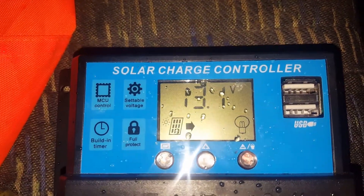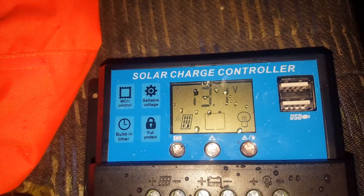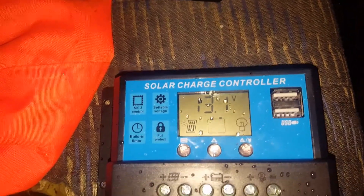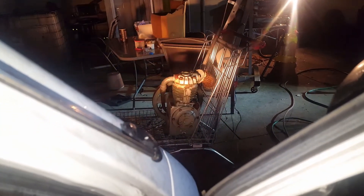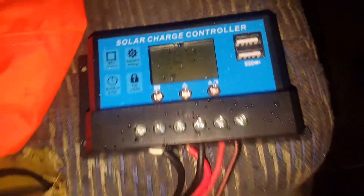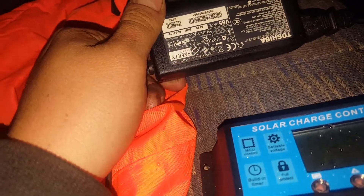It's been about 10 minutes. We're dipping up and down into the 13s. There's a little bit of warmth in the charger — nothing to be worried about, about 10 degrees more than ambient, no big deal. Headlights work. It does take it out of it pretty quickly — it's only about 3 amps at 18 or 19 volts at full noise. It's a bit mean putting a load like that on it, but anyway.